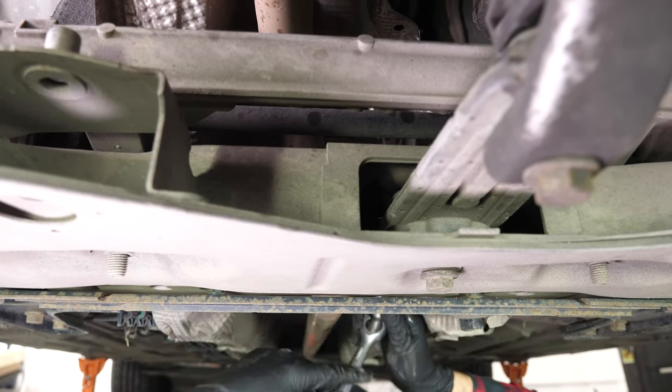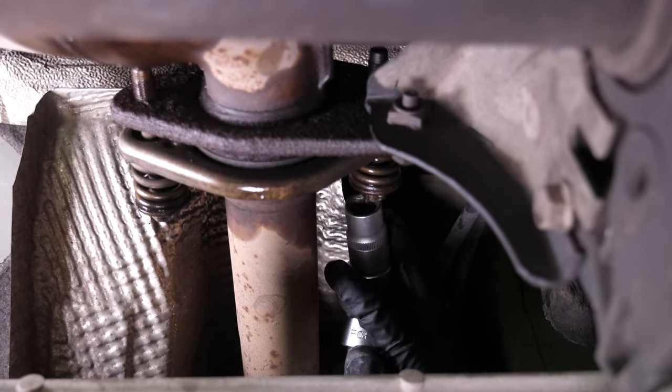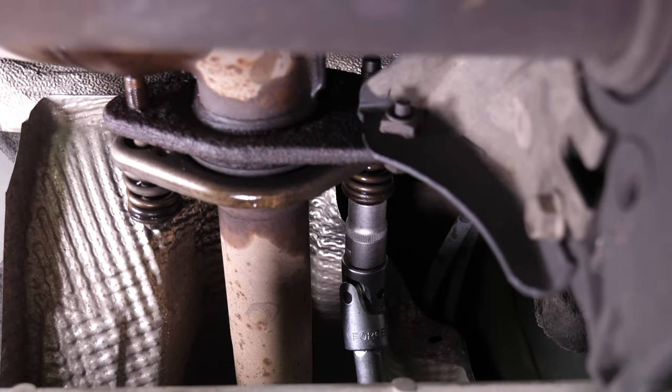You can also unscrew them more quickly by using a socket wrench, an extender, a gimbal and a 13mm socket going through where the line passes.